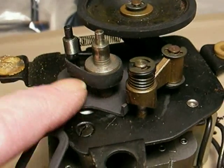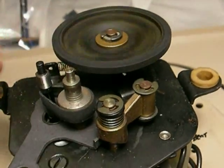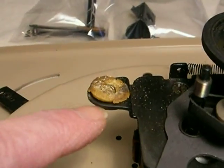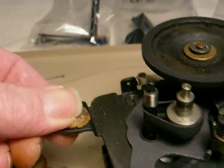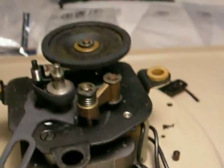This belt — Gary at VM has these. And Gary at VM can rebuild drive wheels for you for these too. This one's already on it and it's in great shape. And this — you see this all the time — the motor mounts have to be changed. They're rotten, falling apart, collapsed. This one didn't even exist. So they're going to be changed with new ones.